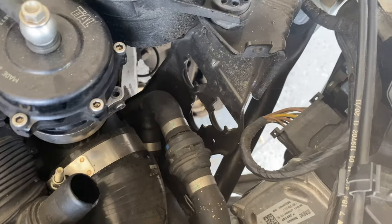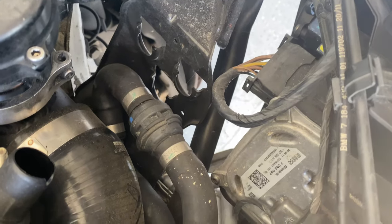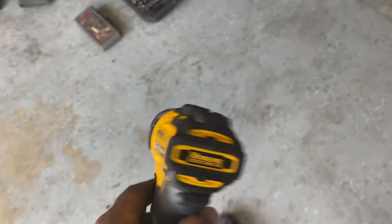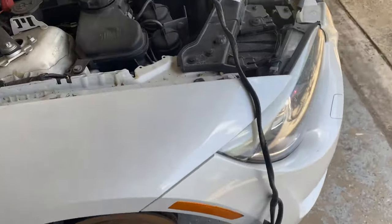The main thing is just to take this whole clip off. One thing I noticed is it has a coolant cooler over here and an oil cooler over here — so these are what they should have come with from the factory for regular builds. That's a nice little upgrade. So far I have the bottom tray off, both sides off, the fan off, and the oil drained. I just need to drain the coolant.